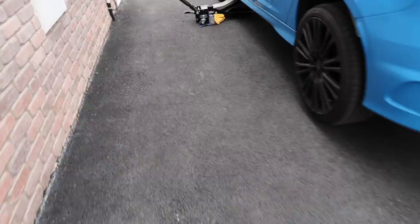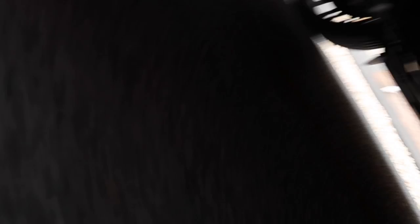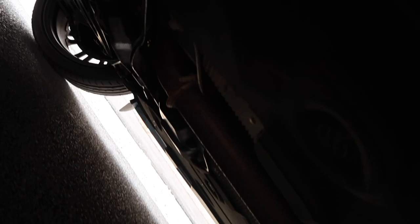The last thing — I'm jacked up with some bits from the last garage update video: the rust converter cloth and a metal brush. There's just one little bit of rust removal to sort out, in a bit of an awkward spot near where the downpipe connects to the exhaust — just a couple of little bits I couldn't quite reach around there. On the other side it's really not in bad condition. I've had this as a little priority for the past couple of weeks and the rest is done. I did have to switch over to a pot of Hammerite and brush it on manually, as opposed to spraying, because the spray Hammerite clogs up really easily.